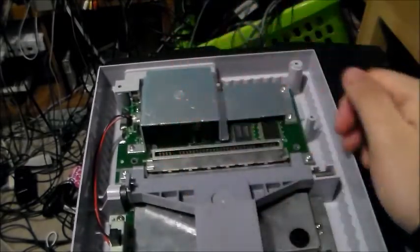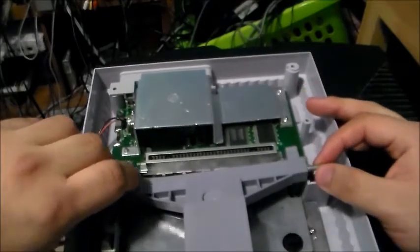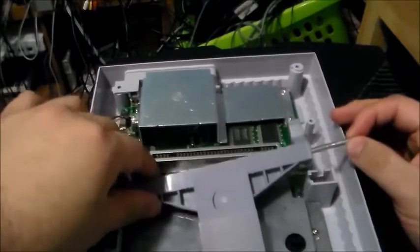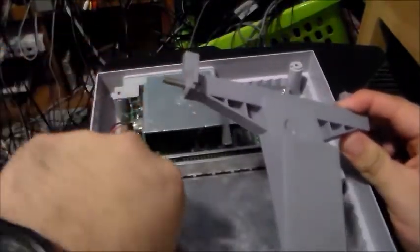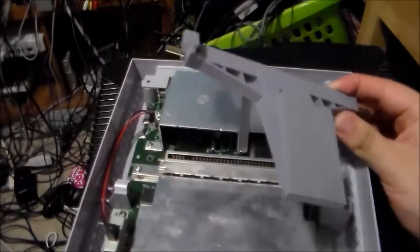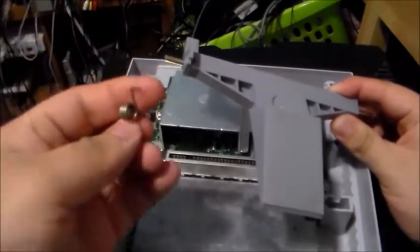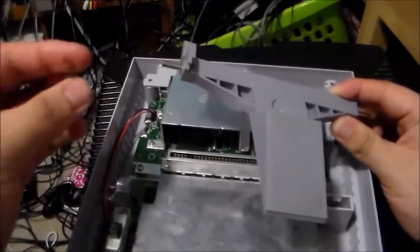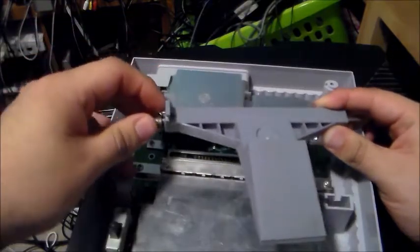The capacitor right there is what I'm talking about. To remove the eject button, you basically lift this portion there. Earlier ones would be bent here and not straight. Then you can take out your eject button. On American Super Nintendos, it's a whole piece, not two separate pieces like the other Super Nintendos and Super Famicom worldwide. This side's short and this side is long, so when you put it back on, you want to be sure the short side goes in the top and the long one goes down.